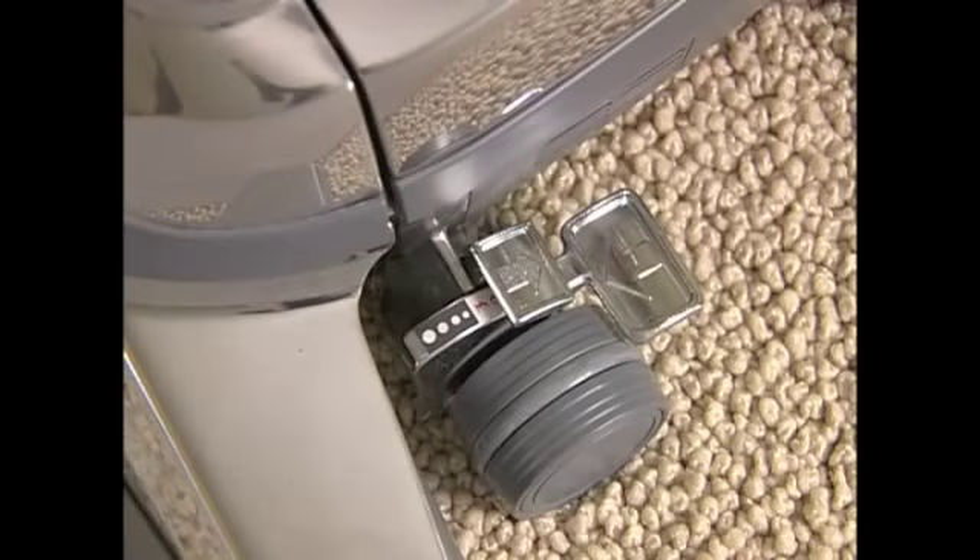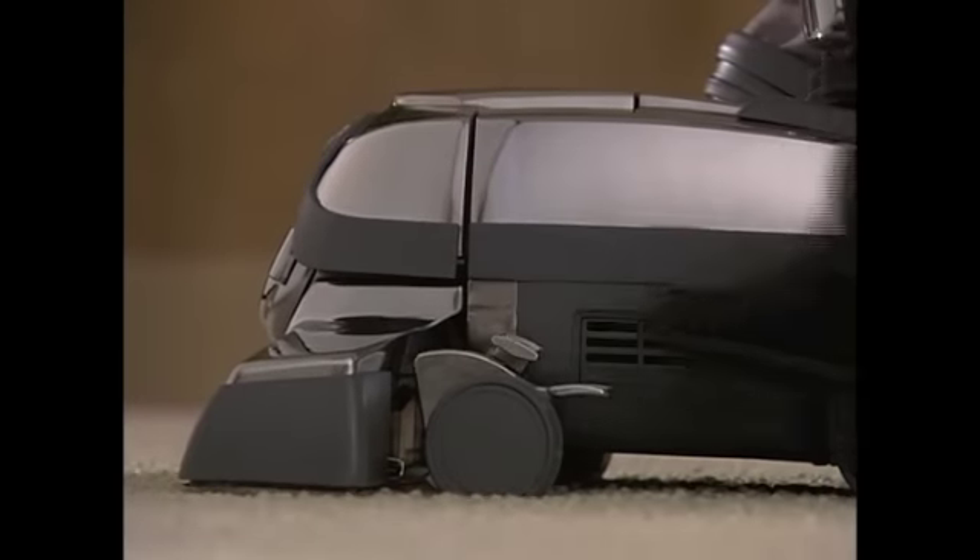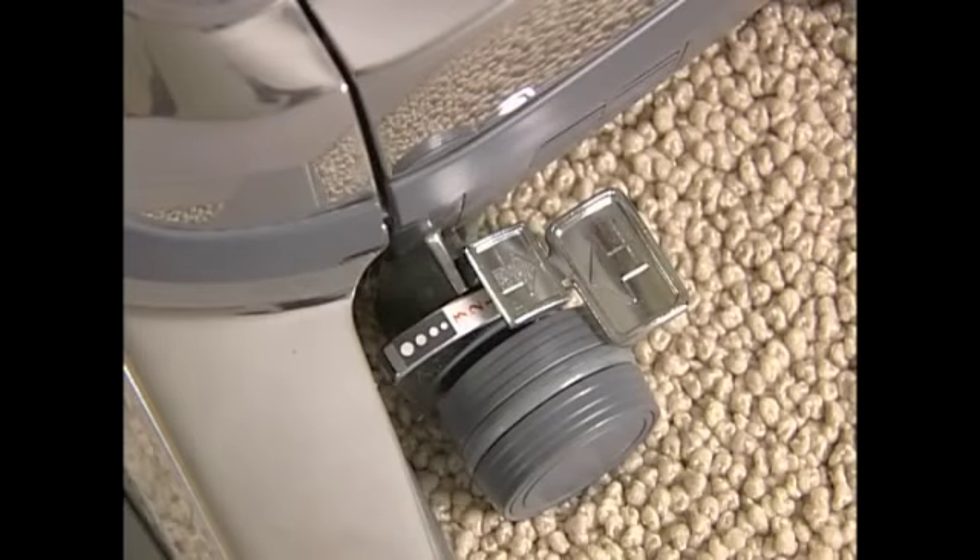You are now in the highest floor cleaning position, used for high pile and plush carpets. Press one more notch down until you see the number two in front of the toe-touch control upper pedal for the medium position. This is the most widely used position for all types of carpet, including medium to medium plush.